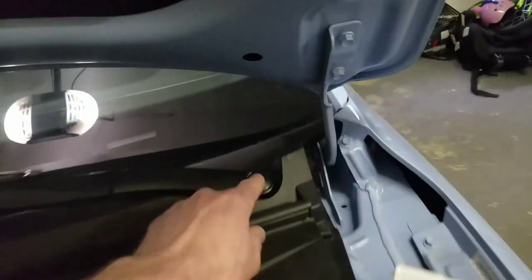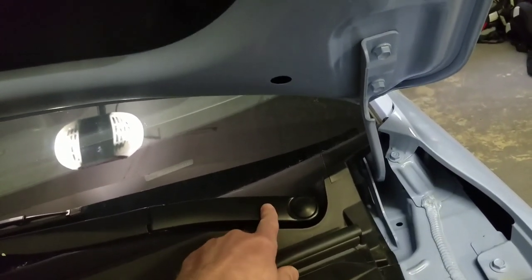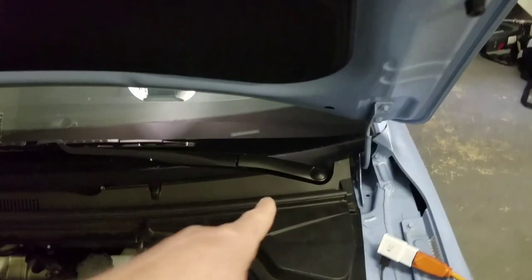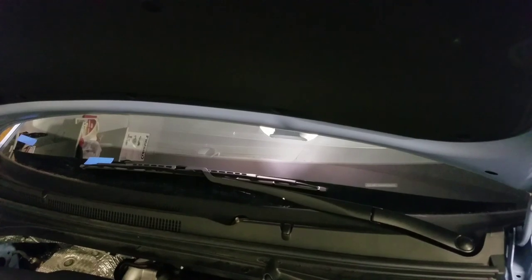The easiest way is to mark the stud with the wiper blade arm - that way you know it's on there. You can align with the tape as well, but I find that very useful and very easy when installing so that it doesn't over travel. Let's get that passenger side on and it should be buttoned up. So that's how you take the sound generator out of our car. I'm Ampul Sen, and as always stay COVID free and drive safe.